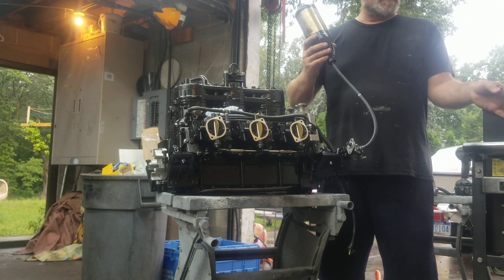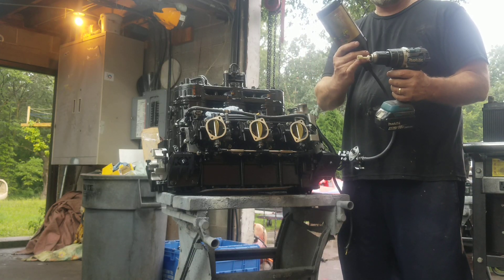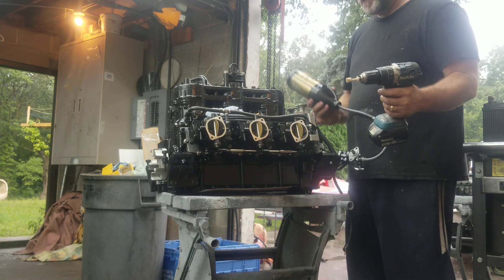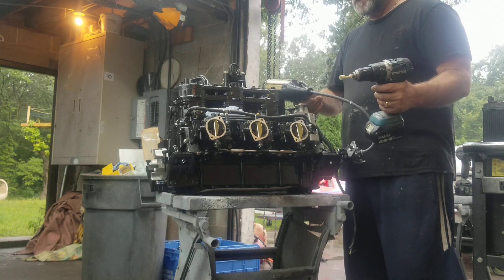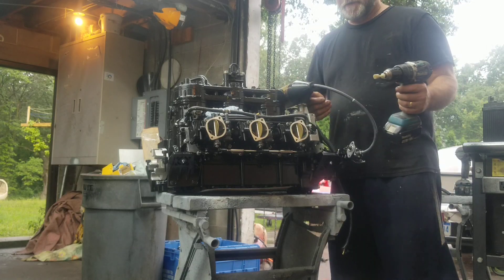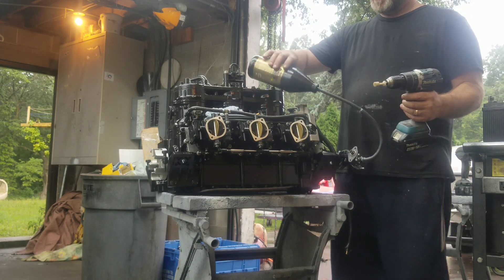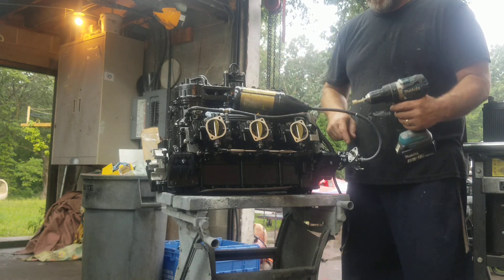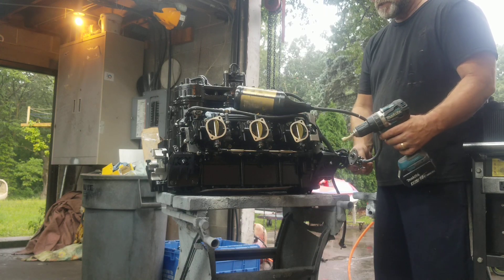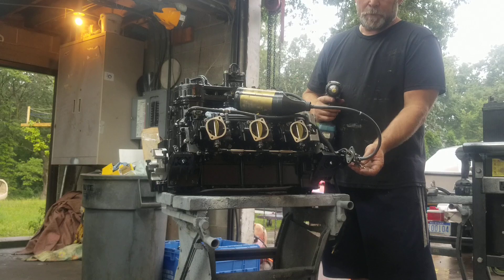So I'm going to do that with a drill motor. I have a little fitting here from a 787 oil pump drive shaft. But you can also use the bolt that holds the flywheel down on a Yamaha — you can use the flywheel bolt when you have the engine apart. That's because it fits this groove where you can just make a tool. Basically there is a butterfly on the end of this pump and I'm going to just hold it open somewhat.